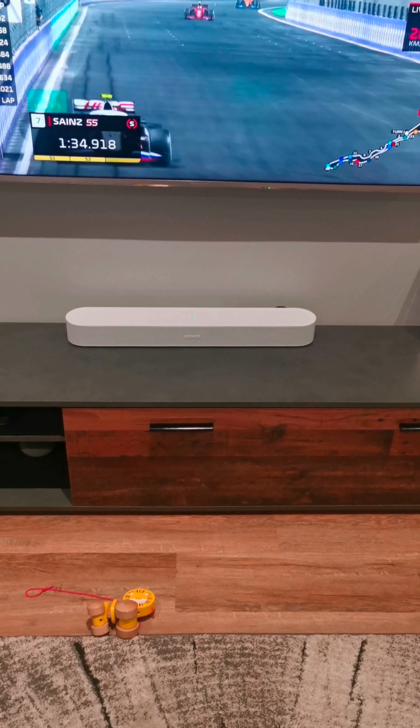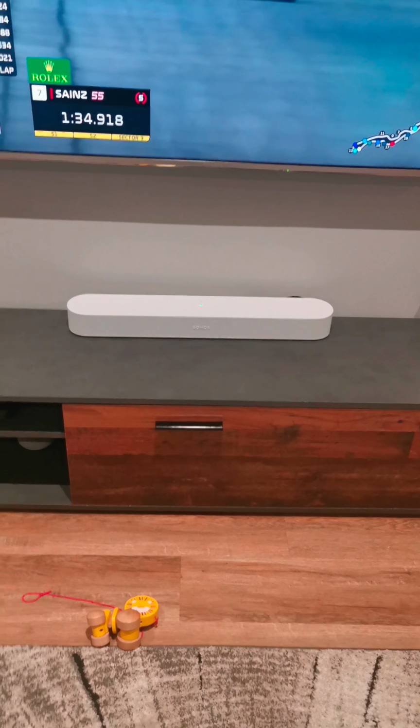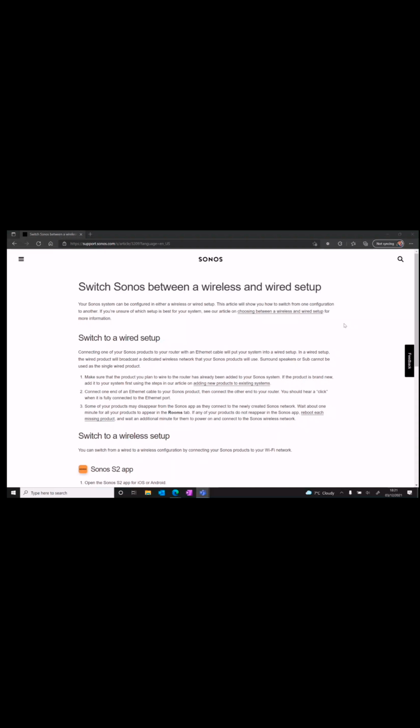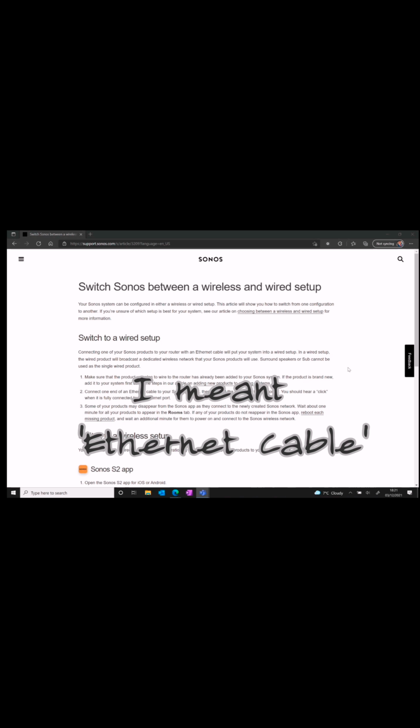So I then had a look online and I came across a solution, and I'll go upstairs and share that with you now. Right, so this is the page that I found via forums, which is a Sonos page. Very helpful. I will leave the link in the description for you guys. But essentially what you want to do to fix the issues I've explained is switch your setup from wireless to wired. So all you need to do is connect one of your Sonos speakers that has an Ethernet port, with my setup it would be the Sonos One, the Beam, or the Connect Amp, and plug an Ethernet cable into that. And what it will do is switch your setup to a wired setup.